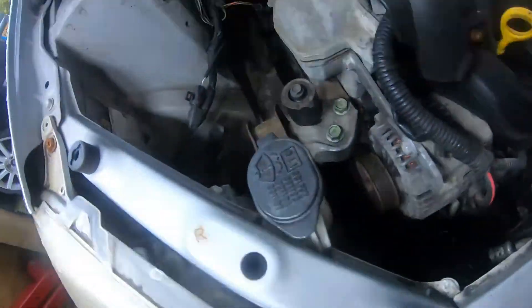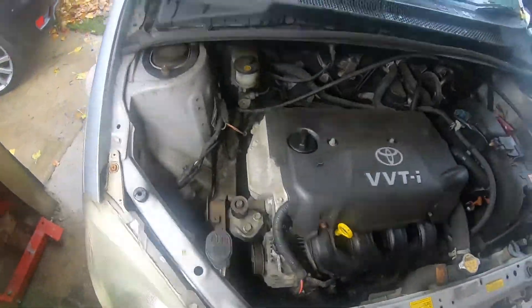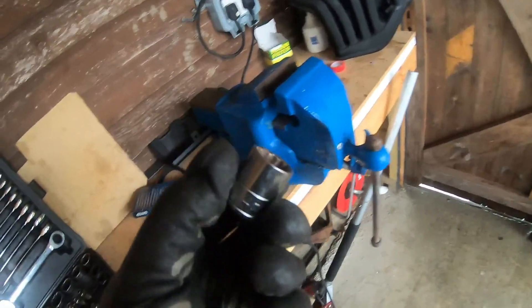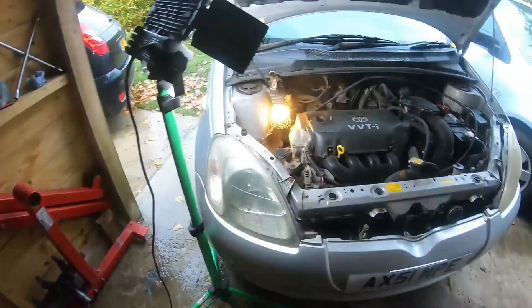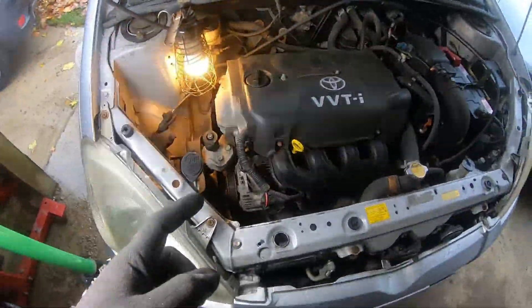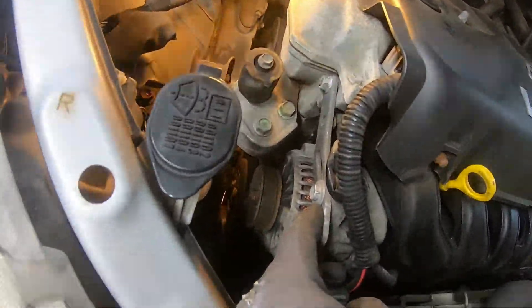Good morning guys, I'm back. Today I'm going to be working on this Toyota Yaris, just going to be changing the auxiliary belt. As you can see, it's fairly accessible down there — manual tensioner on the alternator. It should be a fairly easy job. For this you'll need a 12mm socket or spanner and also a 14mm socket or spanner. Take note there are two different lengths of belt — I've got a longer one because I've got aircon on this.